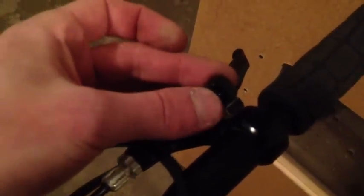From there, all the lines run up the front of the bike, around the cabling. I've got an amp meter which I've modified — I took the current shunt out of it and put the current shunt in line between the battery and the speed controller. That way I wouldn't have to run heavy gauge cabling all the way up to the meter, though it means I also have to recalibrate the shunt to account for the resistance of the small wire running back. For testing purposes I've also run another cable along the brake line to this small potentiometer.